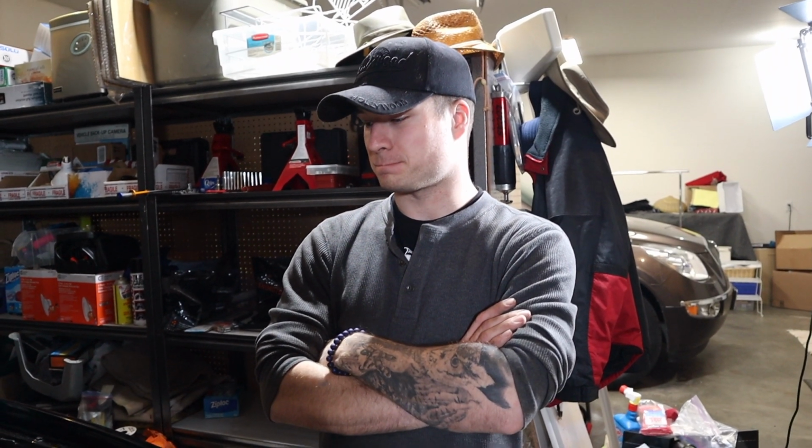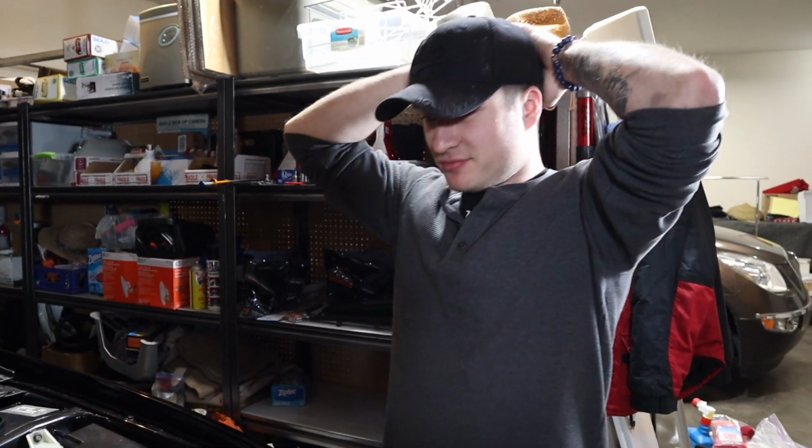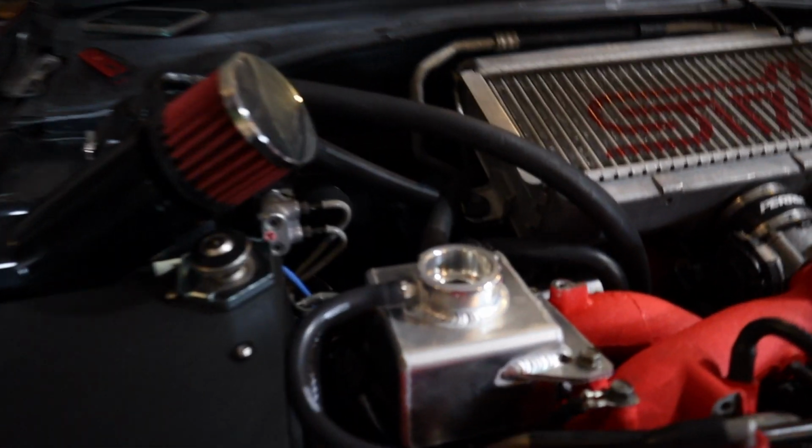Now I have to take off the intercooler. I'm probably going to have to take off the turbo. So I guess we're not going to be starting it today. Yeah, unfortunately. That kind of sucks. Well, we might put this in one whole video, so you guys are probably going to see it started in this video. But we're going to be back either tomorrow or the next day because we kind of screwed up. Yeah, the coolant was completely coming out from that banjo bolt.